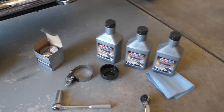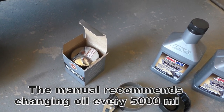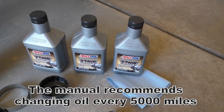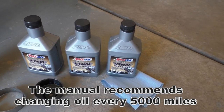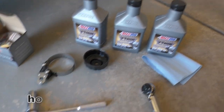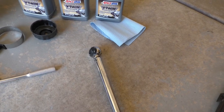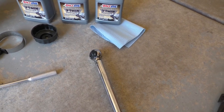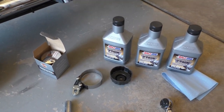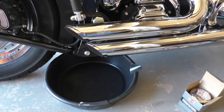Here's pretty much everything you're going to need. Oil pan, oil filter which I picked up from the Harley dealer, also got an O-ring, and I'm using the Amsoil V-Twin 20-50 — it's full synthetic, but you can just use regular 20-50 oil if you want. A 5/8-inch socket and a torque wrench. You don't have to have a torque wrench, but the oil drain plug is 14 to 21 foot-pounds if you want to be technical. Otherwise, you can just snug it pretty tight and it'll do just fine.